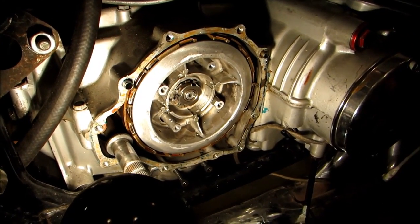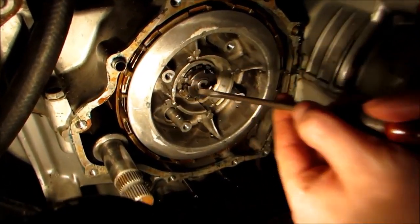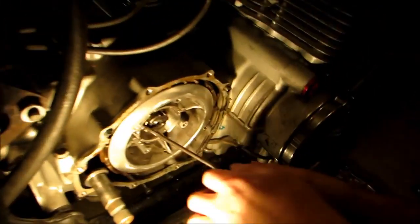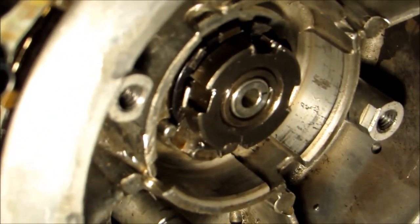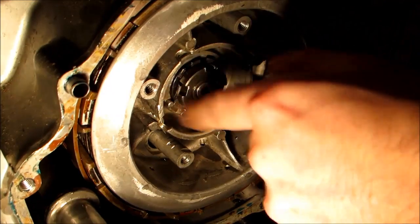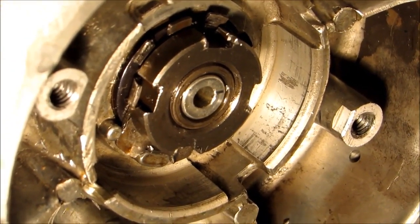So we've got our nut torqued to the lowest setting, 32 foot-pounds, and it looks like actually this tab right here should line up fairly perfectly. So we'll go ahead and try and bend that down. Perfect, that goes right in. So we'll just grab it with our pliers to get it in the last little bit. So now it's nice and flush with the outside. So that's installed. We'll go ahead and each of these posts will have a spring on it.